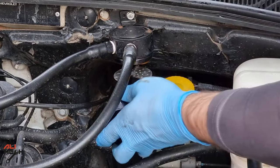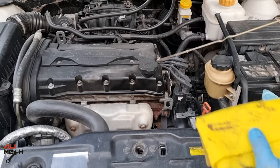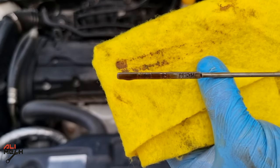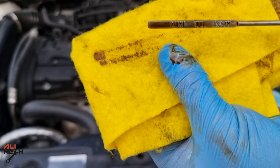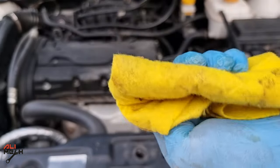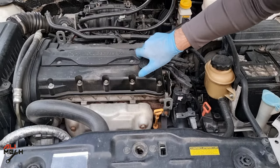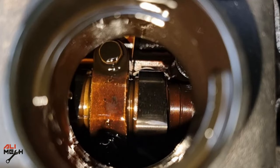After cleaning everything, I'm gonna put everything back. If you wanna know if the engine is fine after seeing that milky oil texture in the oil catch can, check the engine oil. If it's a normal color and not milky texture, the engine is fine — it was just humidity condensating in the oil catch can. I also wanted to show you the inside of the engine and it looks fine with no milky texture. So it was pretty normal, just a humidity thing.